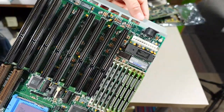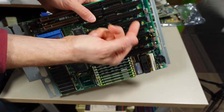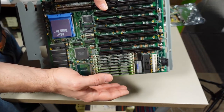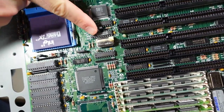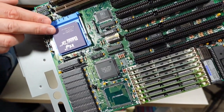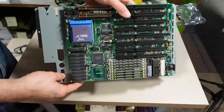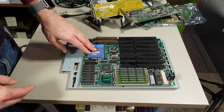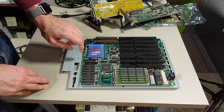I didn't mention this earlier, but I installed two pins where the old battery was, just so I could connect a CR2032 in a holder. It will need a diode because this is expecting a rechargeable battery — it sends 5 volts into the battery when the computer is running. So don't just hook up a non-rechargeable battery. One other tidbit: this motherboard has a crystal oscillator for the CPU speed. The jumpers don't seem to be populated — it's a 33 MHz crystal with permanent things installed where those jumpers go. So this thing is fixed at 33 MHz. Although if you install a 486DX2/66 processor, it still uses the same 33 MHz bus but doubles it internally, so it is possible to speed this thing up by just swapping the CPU. But I'm going to leave it at 33 MHz.